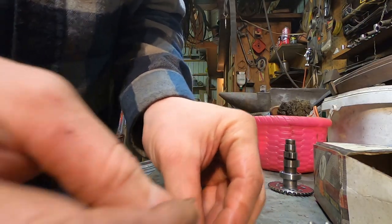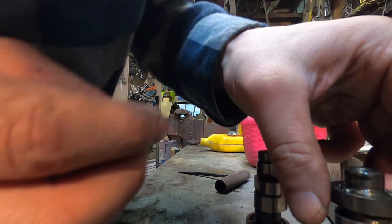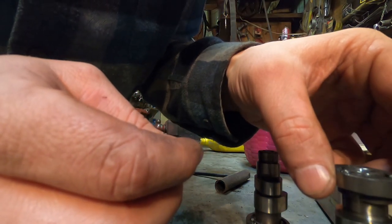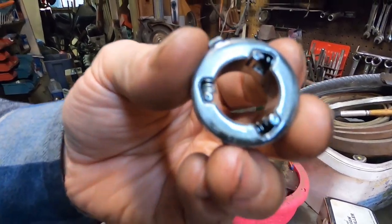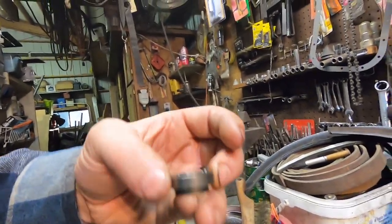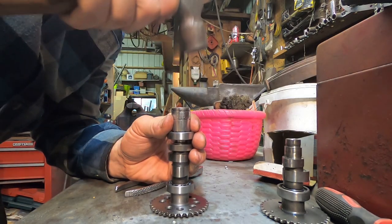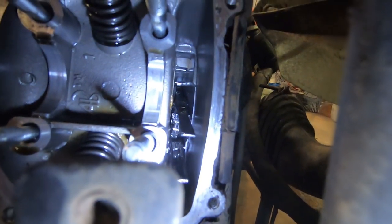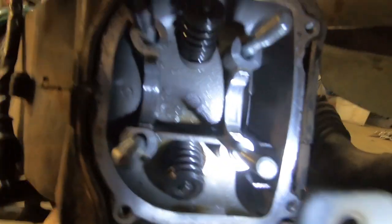We will move this directly over to the other cam. It's spring loaded and I lost a spring too. Totally found the spring though. TF is the marker on this and I line it up with the pointer just to the left. One strong recommendation would be not to turn the engine unless you have something holding the chain up here somewhere — so keep that in mind.